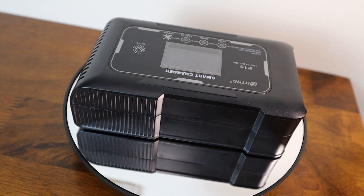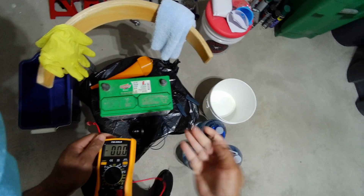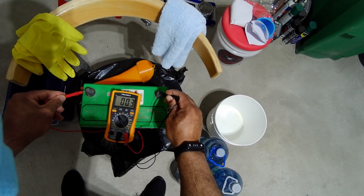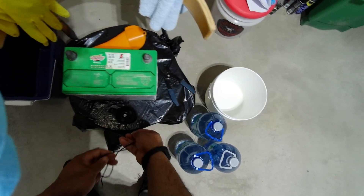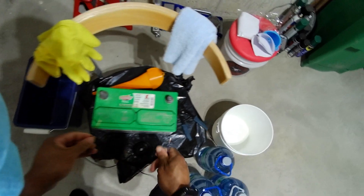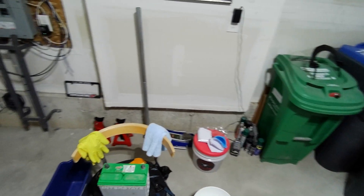On the unit itself you have the fan, the AC wall inputs, and the input for the clamps. This battery has been sitting for a while, so it's actually discharged to 11.8 volts. Even though it's 11.8 volts, you could still run a 12-volt car horn — the horn still works — but it doesn't have enough power for a cold start.